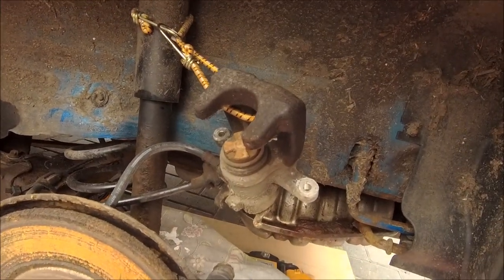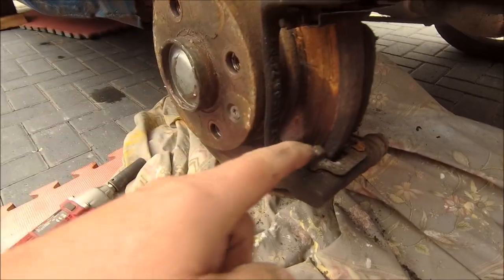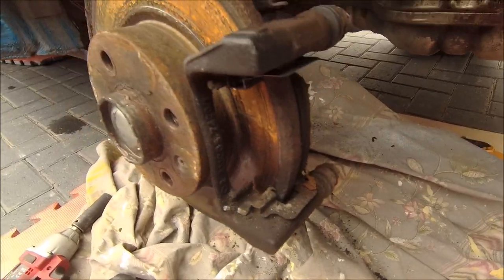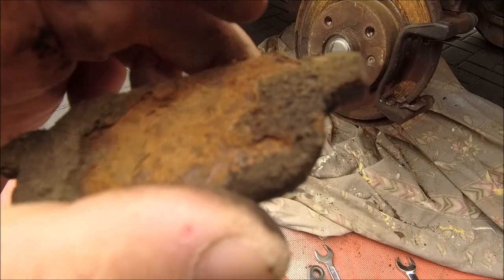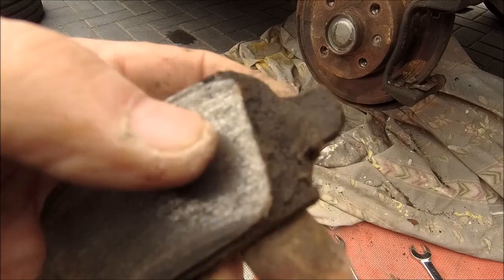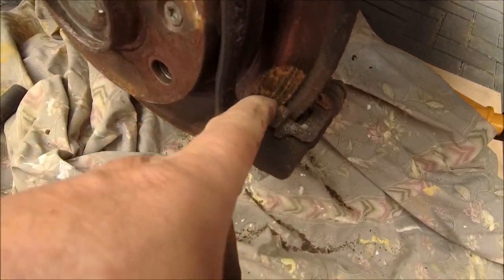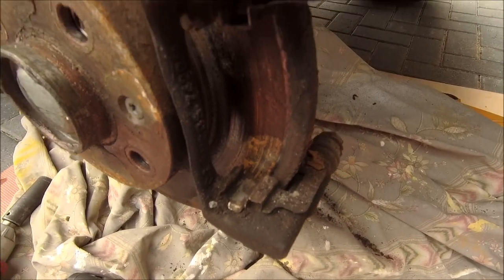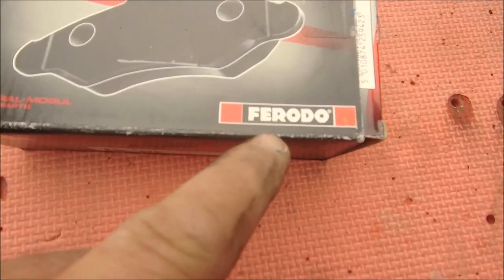Caliper's safely hung out of the way. You can see what I'm saying about the pads — there's not much meat left on them, they're well past their best. Everything else looks pretty good; you've got a stainless steel holder on the bottom there and the sliders on this side are pretty good. I really don't like it when people grease the bottom of the pads — this is the sort of gunk you end up with and it just binds them up. They're stainless steel, so as long as they're rubbing against that they're going to move anyway.